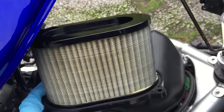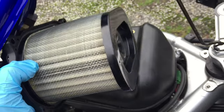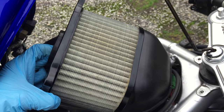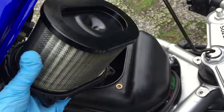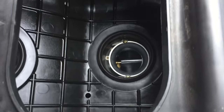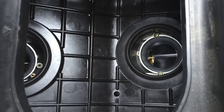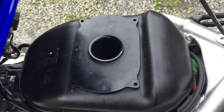Mine's in a fairly good place. You can use compressed air to blast it out if you've got anything in there. These are not particularly expensive parts, so if it's looking particularly aged on your bike, put in a new one. That's where the air is filtered before it goes into your engine. Having a quick look in here — there's no crud, nothing causing an obstruction. You can just see the tops of the throttle bodies coming in through the air filter there. Put the four screws back in and that's the air filter checked.